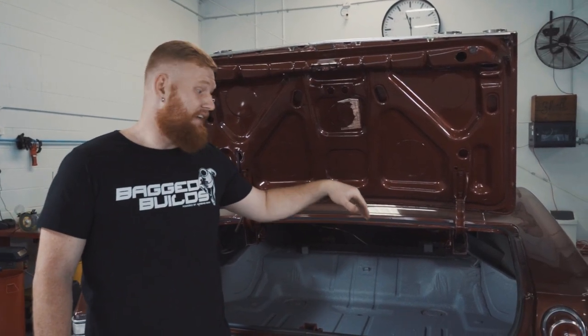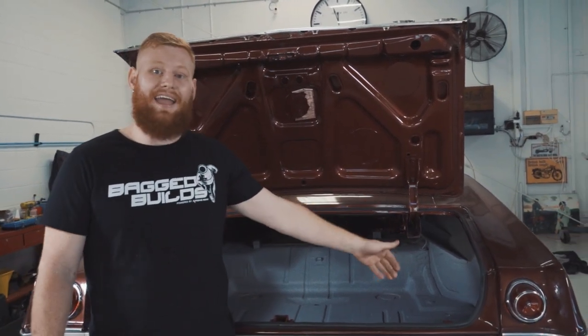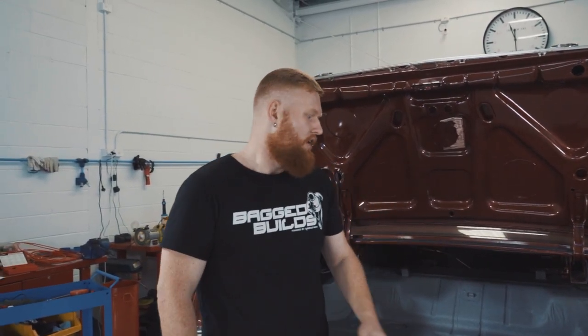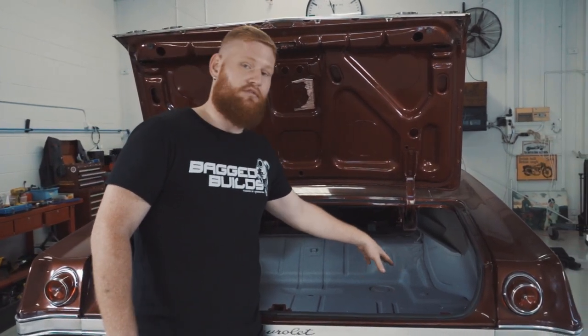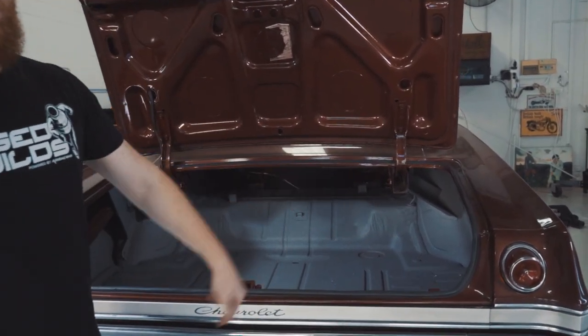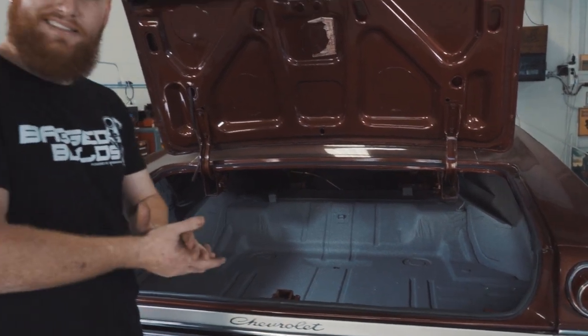So to finish off the airline routing and to allow me to plug it in and inflate the airbags, I'm going to mount the ASU, which includes the compressor, valve block and ECU, and then we'll move on to mounting the tank. So I've prepped the boot and put in a bunch of riv nuts, which will make the install so much easier. So let's get stuck in.